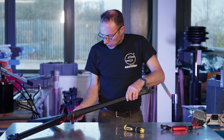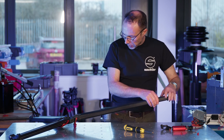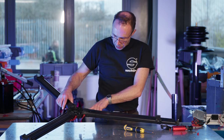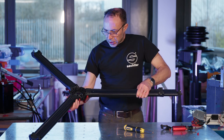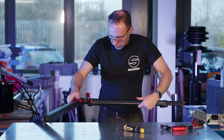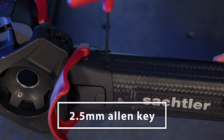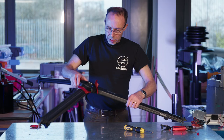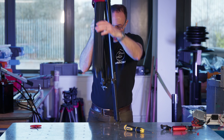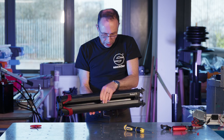Apply the brake again. You may find that the lower section is now a little bit sticky, because this leg had been adjusted to accommodate the initial wear. So at this point, you'll want to release some of the adjustment on that leg. With a 2.5mm allen key, you can go in and wind maybe 10 or 20 turns off. It should now feel better — it's deploying properly. You can then retest the brakes and adjust again if necessary.